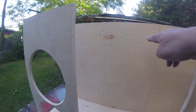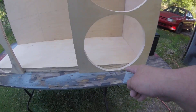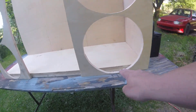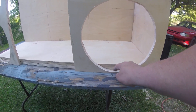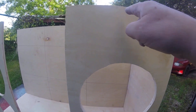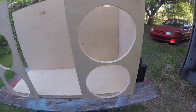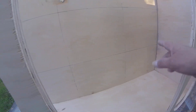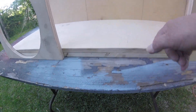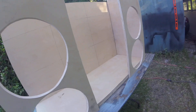There's also going to be a shelf here that separates this little chamber, and it's going to be pushed up quite a bit. This right here is actually what I was going to do as a flush mount, but now I'm going to have to bring it up at least to here — so we're going to lose an inch and a half. That leaves about five inches where we can still do a two-and-three-quarter couple of piezo tweeters, flat flush-mounted with grills — it's going to look super clean. The battery or batteries are going to be here on top.